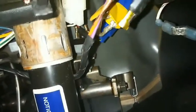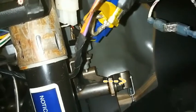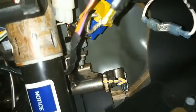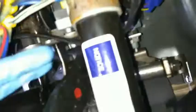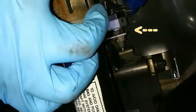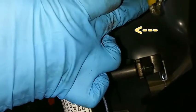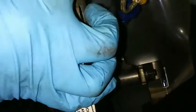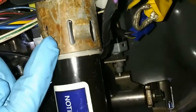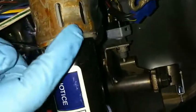There's also the clutch cable, which I have not removed yet because there's some tension on it. It's probably best to remove it from the back, from underneath the vehicle, off the transmission lever, and then release it. There are also two connectors — one here on the brake pedal controlling the brake lights, and one connected to the clutch pedal. On mine I bypassed it because it went bad — it's the safety start switch. On most vehicles you would need to disconnect that one as well.